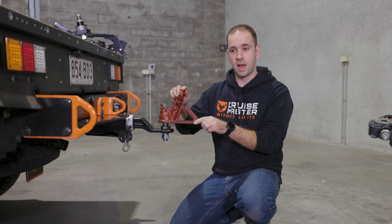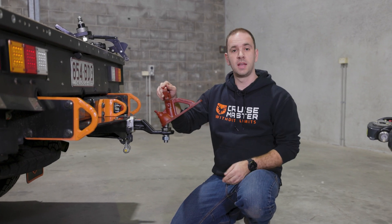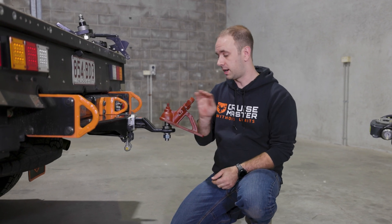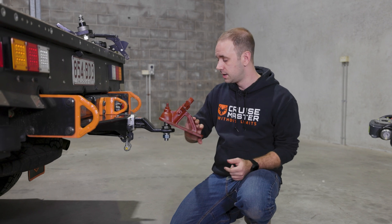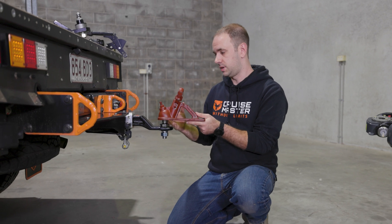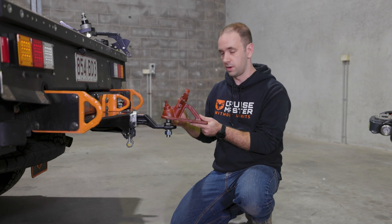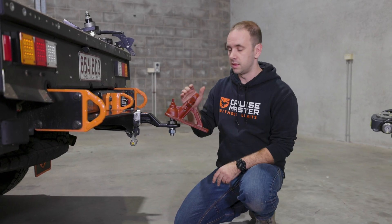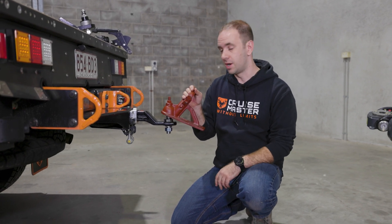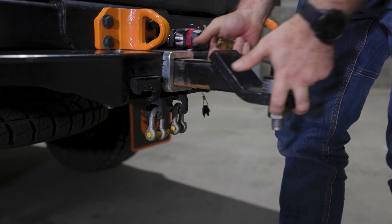You can imagine if you had a very low car and a very high trailer, or alternatively a very low trailer and a very high car, you can see the limit of articulation. In those cases you can run into issues where you start putting extra stress into the tow ball and into the back of the car, and in some circumstances under very high loads you run the risk of popping the coupling off the ball. Pin type or other couplings don't have this issue — we have a lot more articulation in the DO35, so let me change this over and show you that.